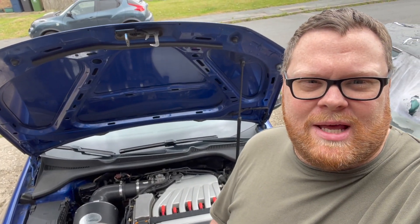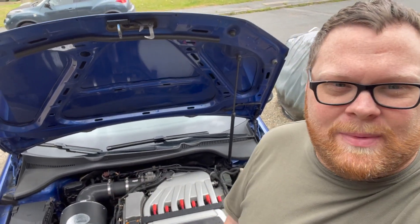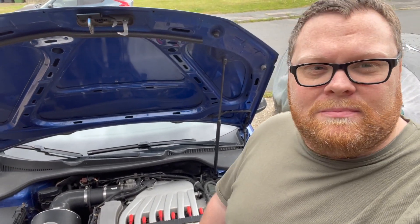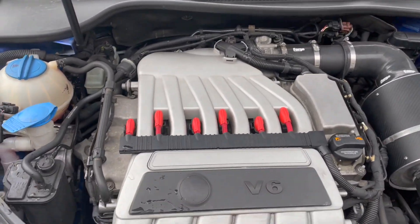I'm glad he recommended it because I did heat soak it and it does bend. So if anyone is getting one of those exhaust manifolds, no matter who you get it from, put it in the oven. I did 80 degrees for 10 minutes and then 20 minutes at full chat - 250 degrees Celsius. The engine started perfectly fine after the compression test with all the plugs and coils back in, fired straight up. It's quite a smooth running engine with no issues at all.